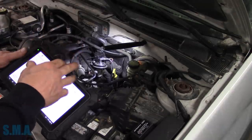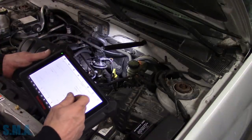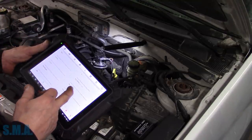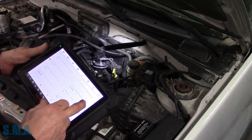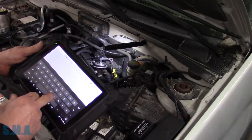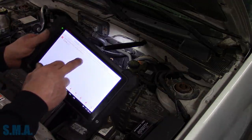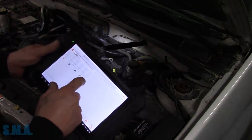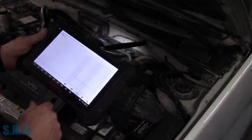So that's going to measure differential pressure in the exhaust when the EGR valve opens. So let's just find that. We'll manually open it and make sure that works. And we'll just drive down the road. And let's see here. There's our DPFE. I don't know as if we have any EGR solenoid, I doubt. No, we don't. So we're just gonna be able to see our DPFE, which is around 1.1 volts key on, engine off. So I'm gonna pull that up into the graph here. We'll put it in the big thick one so everybody can see it.